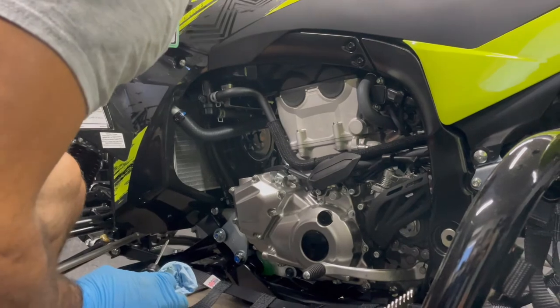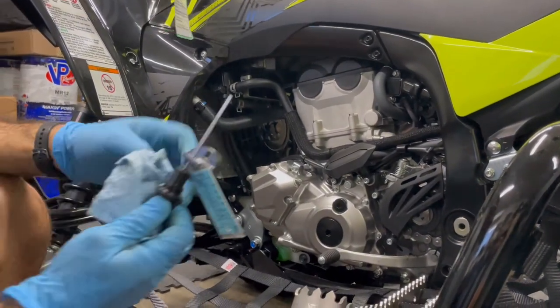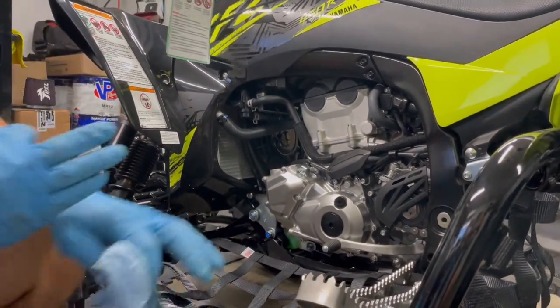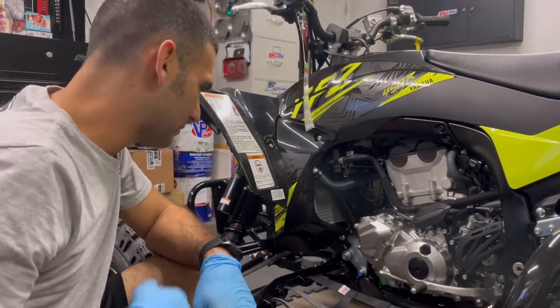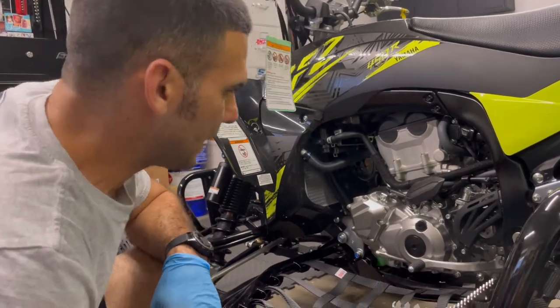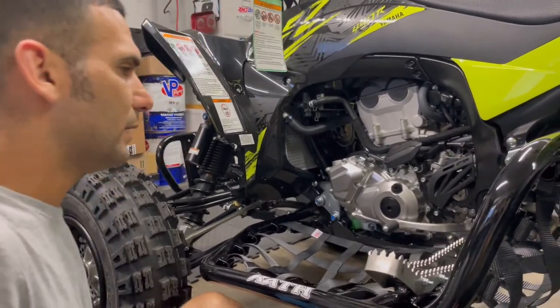And this is just me personally, it's just my way. I always stick the dipstick right through the key and throw it right on the bench. That way I don't accidentally turn this engine on by mistake without oil. I got caught up in something else, I got a business phone call, a question, and it does happen. So anything you can do to help prevent an accident is a good idea.